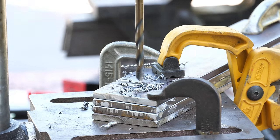We'll do this on both sides of both shackles, and that little bit of extra play shouldn't be a problem since when the bolts are torqued down on the car, there will definitely be enough force to pull the sides of the shackle back in. With those fitting how I want them to, we'll consider them done and ready for paint. We finish those up just in time for the bolts to arrive.